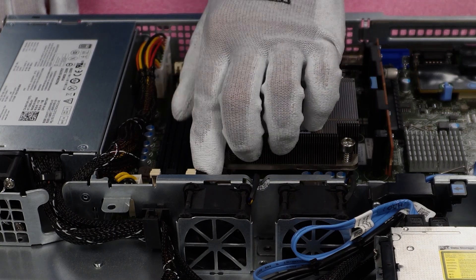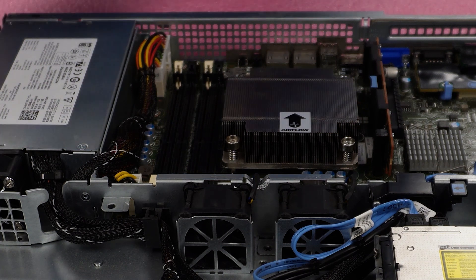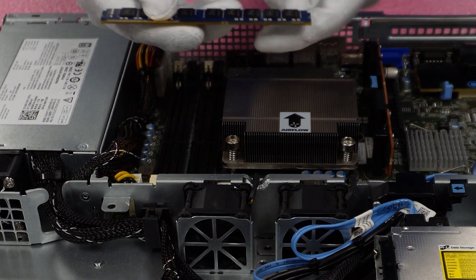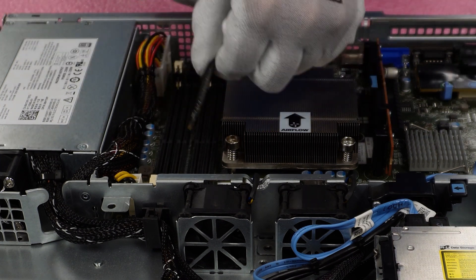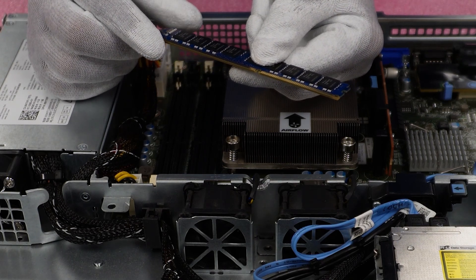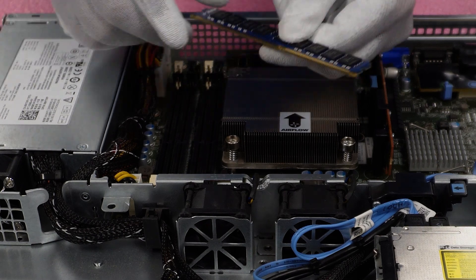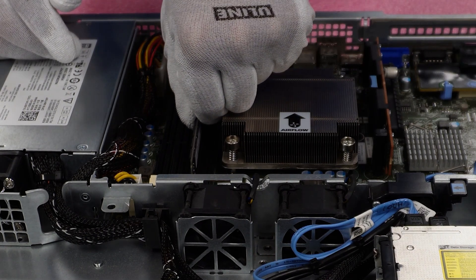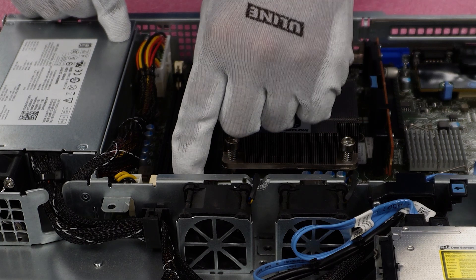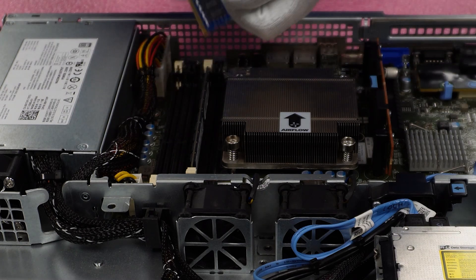One of the things I always like to do is pop open all of my tabs so that when I seat my memory, everything is easy to install. The other thing I always like to point out is that when you're installing your DIMM, there's a notch known as a key, and that notch is not perfectly centered. Because it's not perfectly centered, you need to make sure your module is lined up properly — in this case, facing that direction. This is a VLP module. There's technically a VLP (very low profile) and then a low profile, which is what you see most of the time. Both work just fine. So we're going to slide this in and you want to hear those two clicks, letting you know that your tabs have come up and successfully pulled your DIMM into place so everything is going to register.